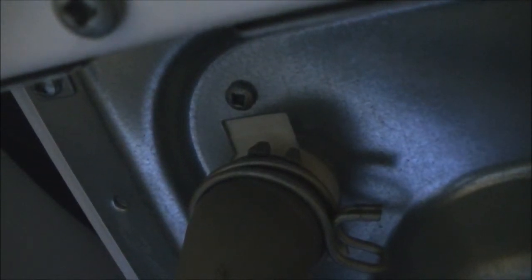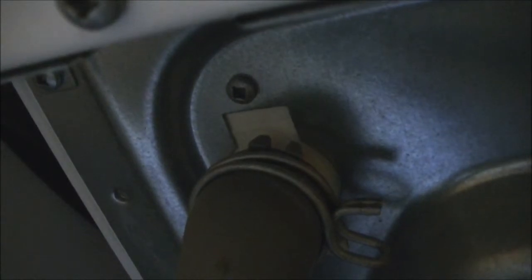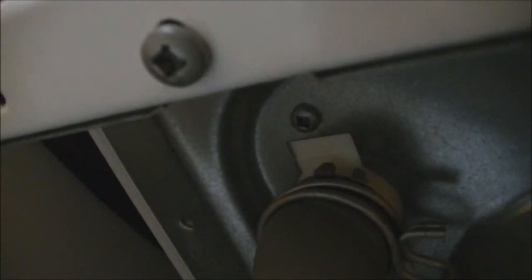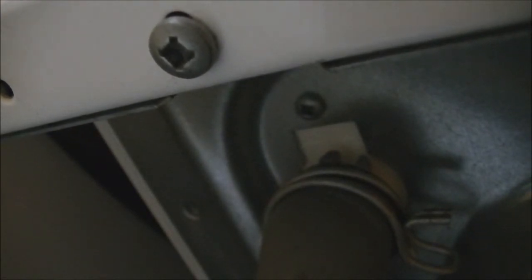This is how the drain connects up to the tube — the hose that actually goes into the drain itself. It's hooked on with one of those clamps, but it's a little easier because it's smaller, and it just hooks right on there. Now, this is poorly designed because inside there, where you see it coming out, it comes up at a right angle — it makes a hard turn before it actually gets into that hose. And it turns out that it was all clogged up. So I took that off, pulled the stuff out, and now my washing machine works.